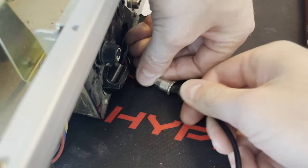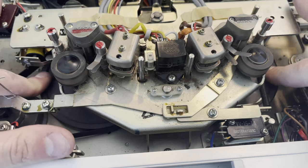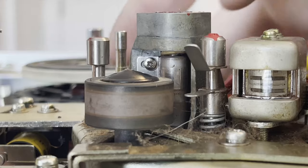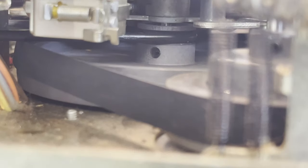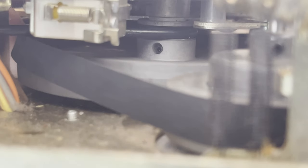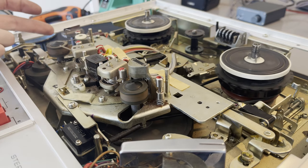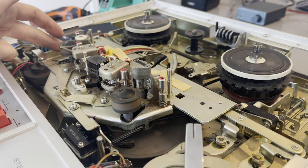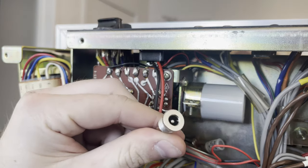Got the wheels back on and plugged it in — and there's a terrible noise. Something's not right, something's scraping. It seems to be that left flywheel — it's loose. That's the one that was torn out when I was trying to get the belt in, and I jammed it back up but it didn't catch. There's a little gap and also a little set screw there that I didn't realize until investigating the scraping noise. It definitely would have been easier to take those set screws off and remove the entire wheel first.